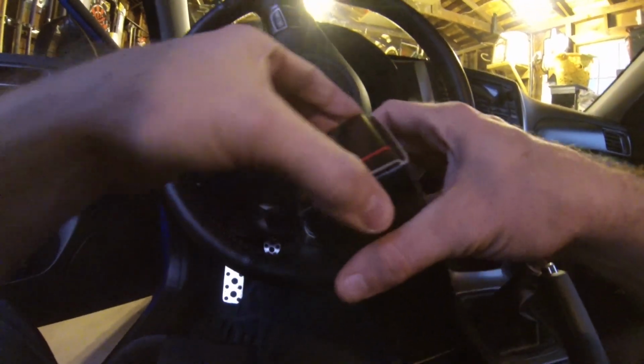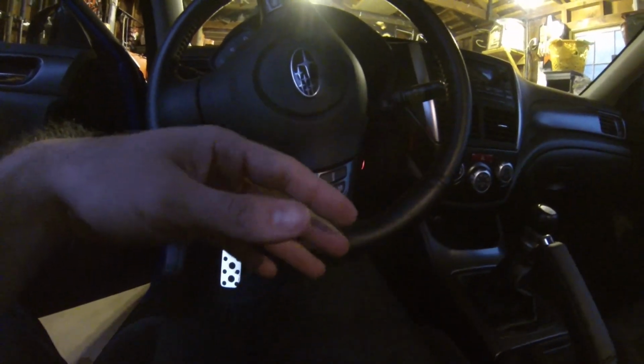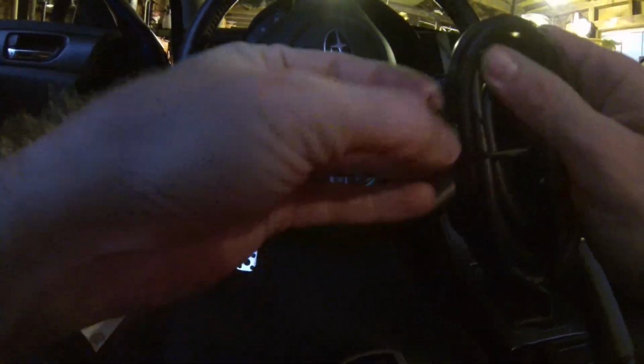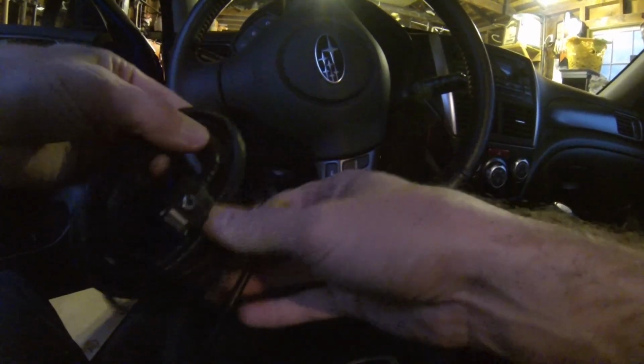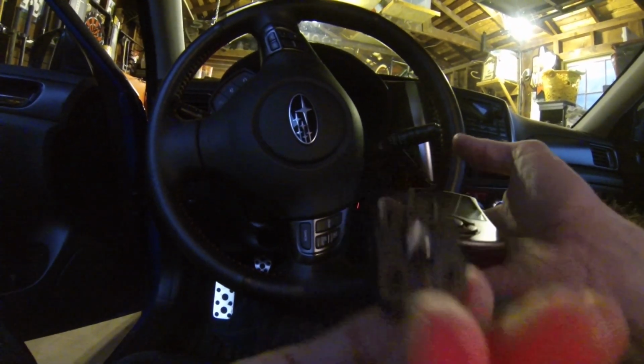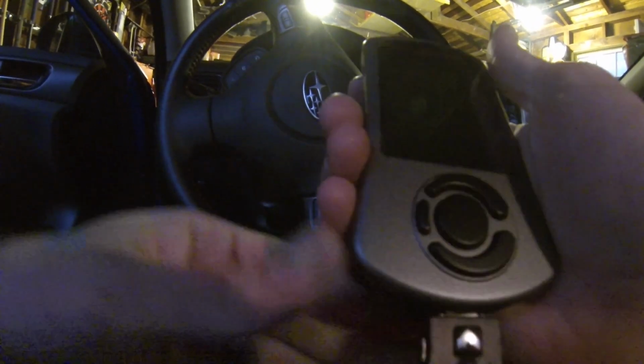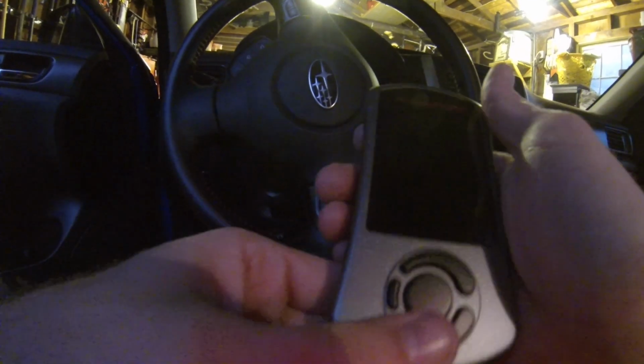Alright, so go ahead and get back into that accessories box. Take out that mount there and put that to the side. Grab the OBD2 cable. Let's take the nice little wire tie off here, and go ahead and hook that into the Accessport right here at the bottom. It's keyed one way. There's a little arrow on there, so that goes into the front, and it will click in. You should hear 2 clicks for both sides, so you know it's in there good.